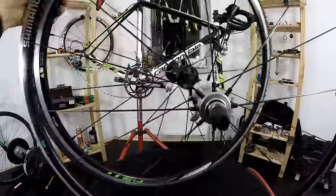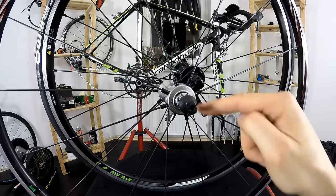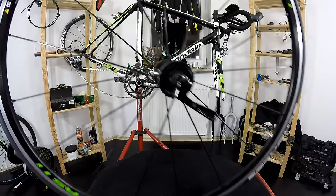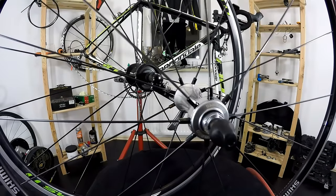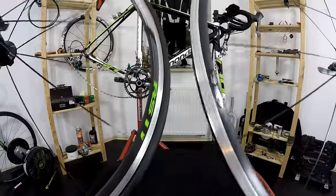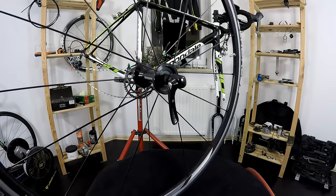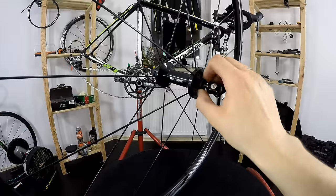Another thing is the lacing — this is a simple radial lacing with equal spacing on the nipples at the hub. Here it's made like two-by-two, and I don't really know the reason for that. I don't feel it improves anything, because this wheel just feels better. We have the same rim width of 21 millimeters, the same profile of 24 millimeters, and the same number of spokes.